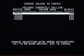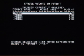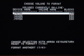ADD Pro will prompt us for the drive to format. The first one is the internal drive. Hit Enter to select it, and answer Y to the ready-to-format prompt. When it's done formatting, answer N to the FORMAT ANOTHER prompt unless you want to format another one.